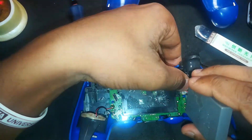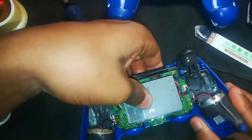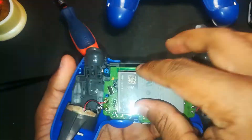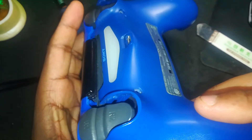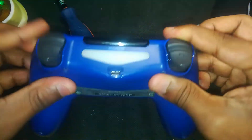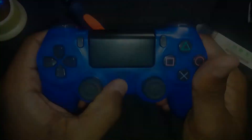Connect the battery connector back to the board, then carefully place the battery onto the plastic shield — make sure everything sits nicely with no pinched wires or loose parts. Go ahead and mount the back shell carefully; before fully closing, connect the flex cable gently and make sure it's seated right. Then press the shell together and snap in those side plastic holders until you hear the clicks. Finally, screw in the four back screws to lock it all down — don't over-tighten.